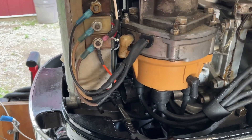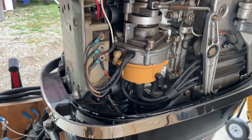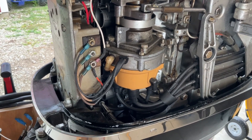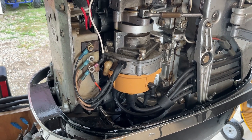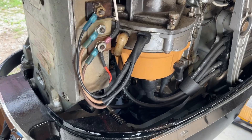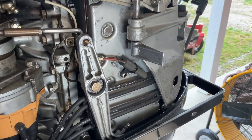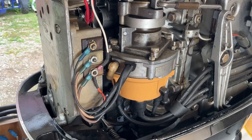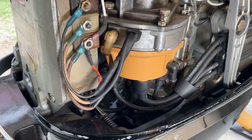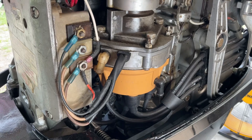Similarly, you'll see this orange wire. That's kind of unique for my boat — originally on the wiring diagram there wasn't anything set up for what I call a tethered kill switch. It's another safety feature, like the tethered kill switch you attach to your life vest. If you ditch out of the boat, it kills the ignition at the control box up by the helm. It serves basically the same function as that tilt switch — it just shorts out the box so it will not energize any spark. If you've got a setup like that, removing it could potentially isolate another problem — those would be like ground fault problems, typical for wiring or switches.